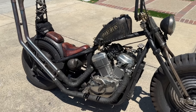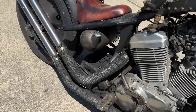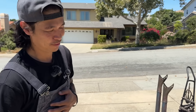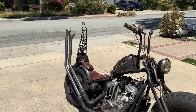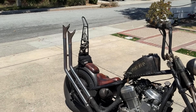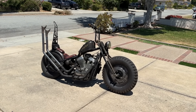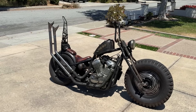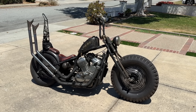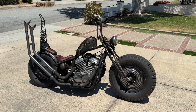My shotguns were two-inch, these are inch-and-three-quarters. When I get that new rear wheel I gotta go hydraulic for the brake, and that's gonna be some work. Custom — that's what it's about. It'll be a one-of-one. I like the look of the front wheel being bigger than the rear, like a 21-inch front with a 16-inch rear — the lines of it just look better.